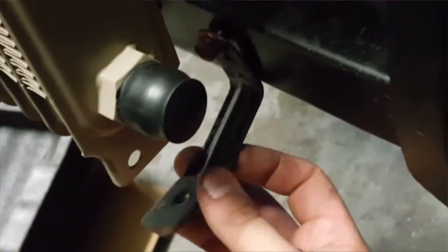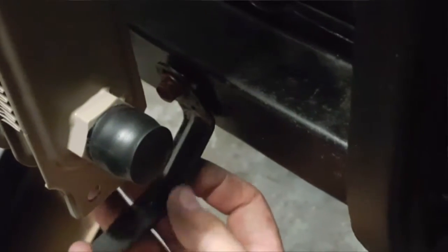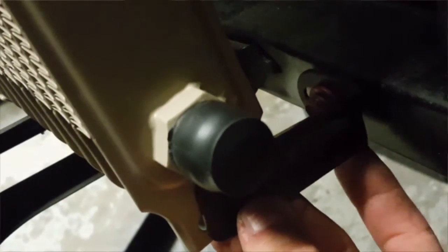This normally never happens to me — I actually got lucky. The factory mount is this piece right here that bolts to the back bumper support and radiator support, but if you just twist it up like this — look at that, that's perfect right there. All I need to do is tighten that third mount.